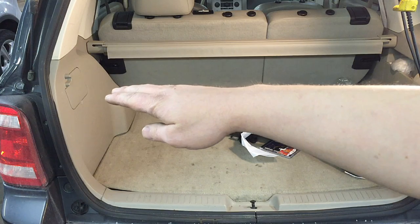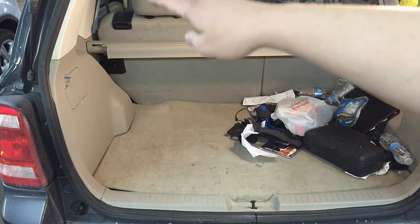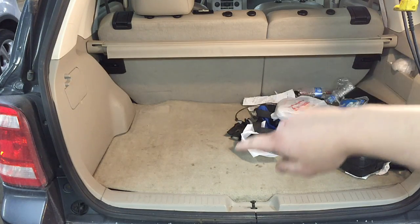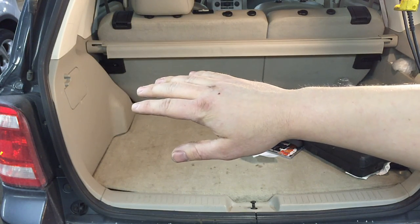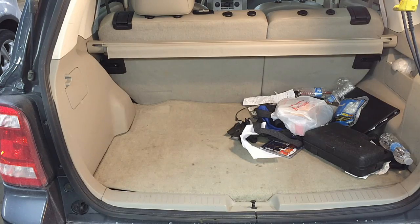This actuator is not too bad to get to — it's kind of buried over in the left-hand rear quarter panel interior trim panel. We're going to pull that off along with the upper D-pillar trim panel. To do that we need to get the seats and some covers out of the way first. You don't have to disconnect the negative battery cable or the high voltage battery at all — there's no danger. Once these trim panels are out of the way it's pretty much out in the open.